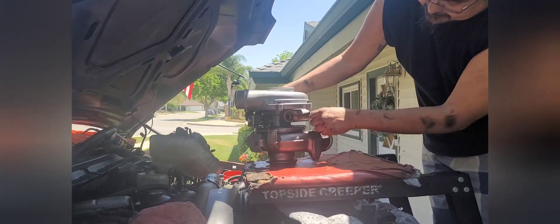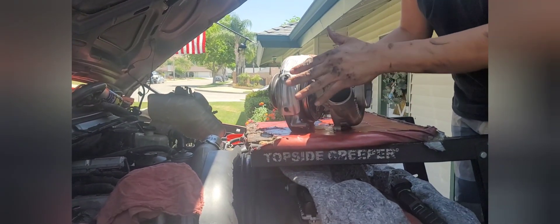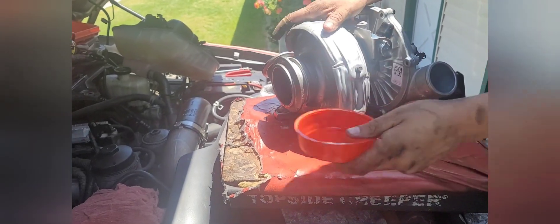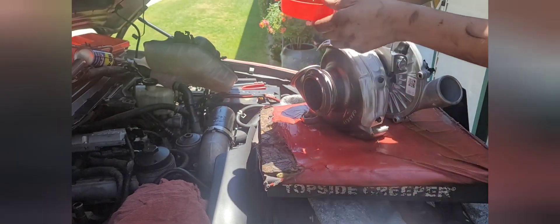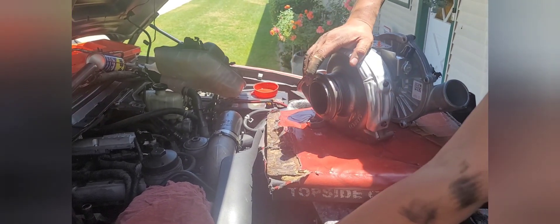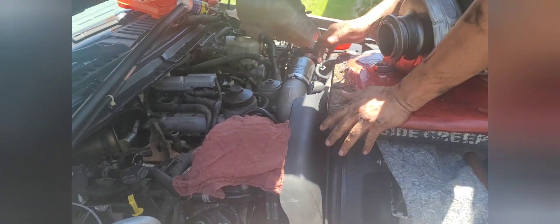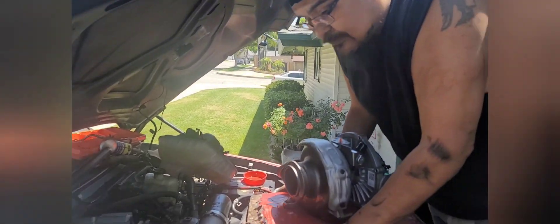Before you go back together and put the turbo on, on the bottom there's a blue cap — take it out so you're not fighting with it, don't forget it's on there. They have caps like this on the exhaust housing side too — you'll see all the oil that's in it, so have a rag to wipe up the oil so it doesn't drip. Save these caps — they're good when you're capping stuff off if you're smoke testing later. Also, disconnect your wire to your alternator or cover it up real good with rags so you don't arc it.